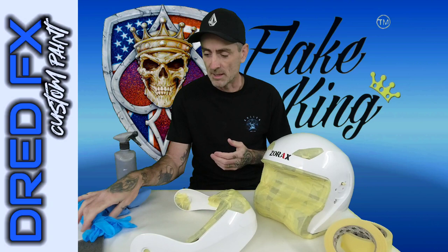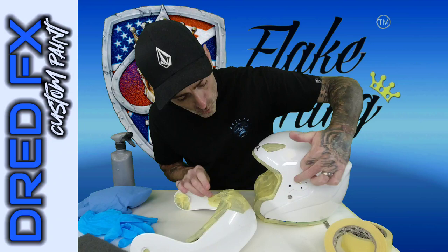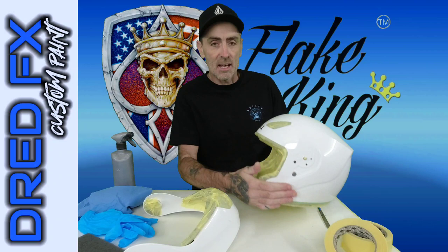So it's going to be a pair of gloves. We've got a grey Scotch-Brite. We've got some panel wipe degreaser, and we're basically now going to prep all these white areas with the Scotch-Brite and just knock this shine out of the lid and give this a really good key, ready for our base coat. So that's the next stage. I'll see you in the next time lapse.